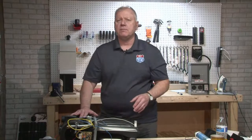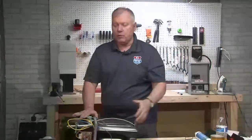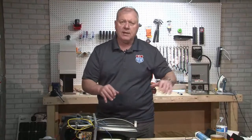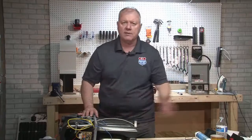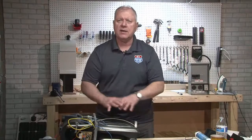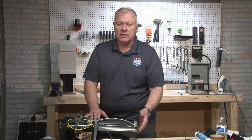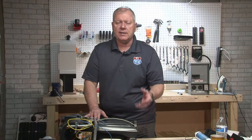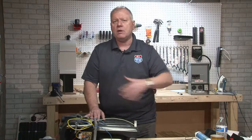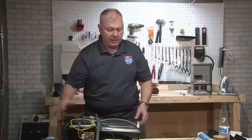The other thing I would also check is to make sure you don't have any of your vents inside covered or closed, because you have to have that airflow. You have to have that movement inside. And if you cover or shut your vents inside the RV, then it won't allow the hot air that's being pushed out of this burner assembly to go out into your coach. This is going to get hotter and hotter and hotter. And there are times where eventually you will ruin this temp switch, because it'll shut it off, but it does it so many times that it'll ruin it until it cools way down. And sometimes it takes 2 hours to do that. It opens up. So make sure all your vents are open, check your batteries. Then from that point on, again, probably a module board, and that's when you need to probably take it in.